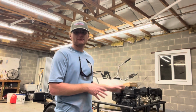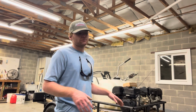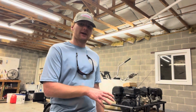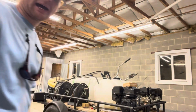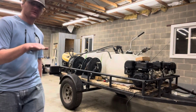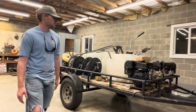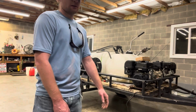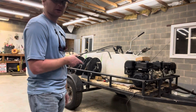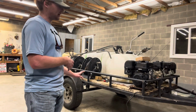So this is going to be our backup rig for this coming year of 2022. We recently repainted the trailer, sanded it down, and we actually moved the axle backwards on it. The axle was a little too far forward, and it would make the trailer kind of sway when it was going around. We also resanded all the boards and put a sealer on them, and it's all different equipment on there than what we had on there in the past.